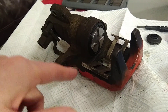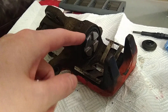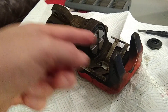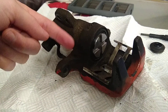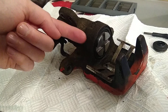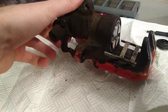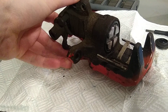I've just taken the caliper apart. It's quite interesting inside — you've got the piston and then an arrangement of a spring, a big washer, and a circlip, which holds in a threaded piece on the inside of the piston. That threaded piece fits as a female thread and threads into a male thread that comes up through the center from the back, and that's for the self-adjusting handbrake mechanism. You can see there, as I pull this lever, it just moves the piston.